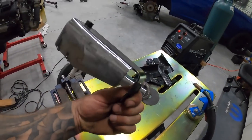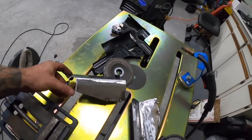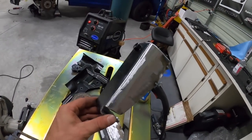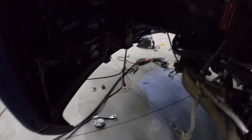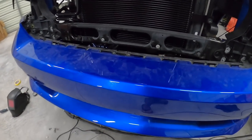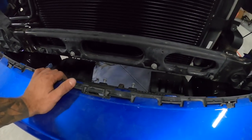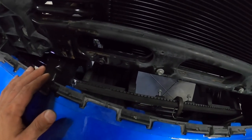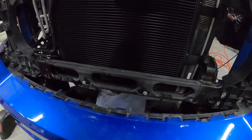Here's the end result — hit them with the flap wheel and you can't even tell we cut and welded them. I'm tacking them on the frame and test fitting the bumper to see how it all plays out. I'm going to open up the air dam and our oil cooler is going to sit right there with air forced into it. Checked our clearance and nothing's hanging below the front bumper line, so we're golden.